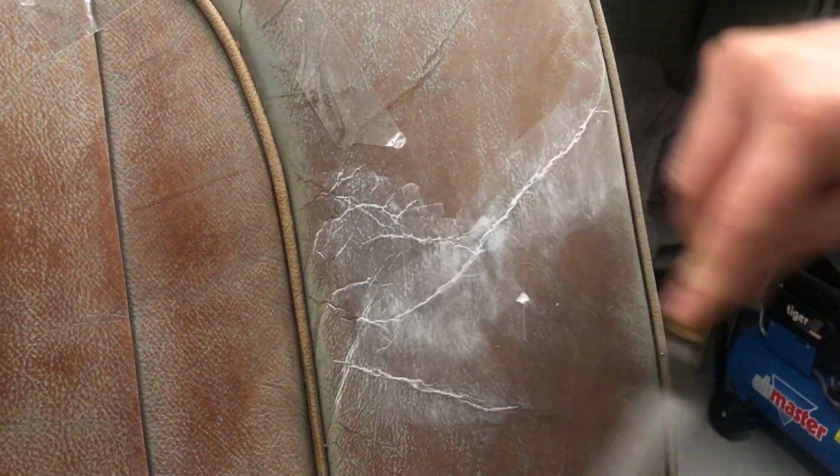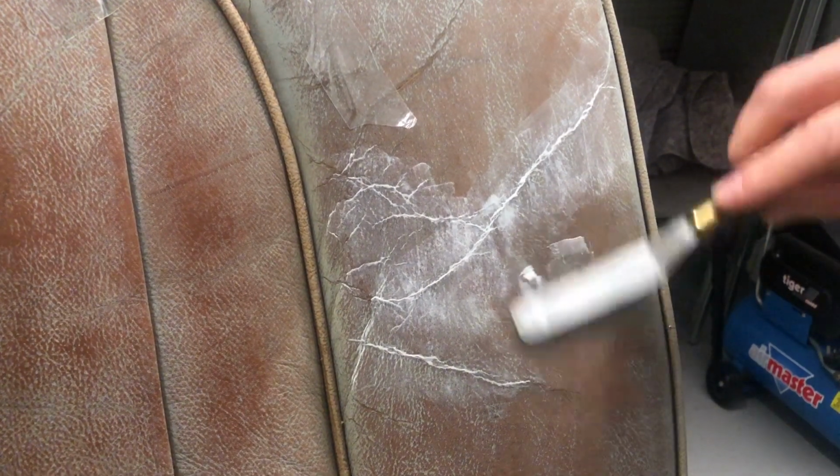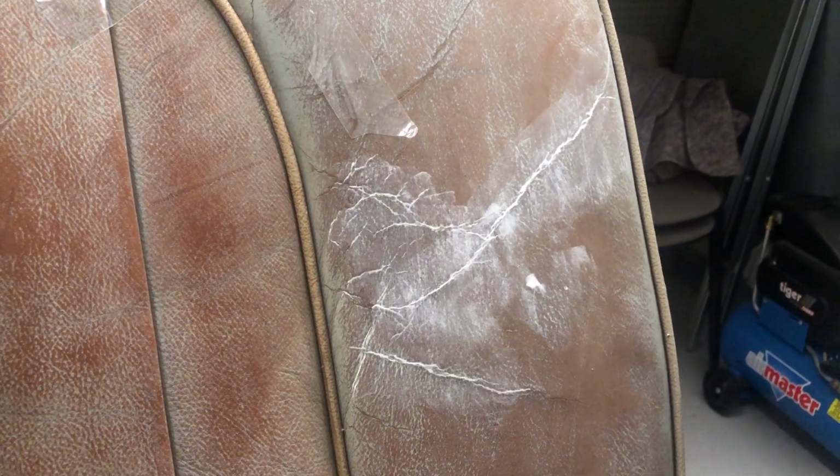You might find that with this cracking, once you've gone over this with the heavy filler and you've sanded, you're not going to tell whether it's perfect until you've got your first coat of paint on these seats, which is obviously going to be the next stage that we're going to do. Once you've done that, you'll be able to sand it a little bit better and tell whether you need to put any more filler in there. And if you do, you'd best put in the Flexi Filler, because the cracking's much finer. It's a bit like putting a guide coat of paint on a car. Put your primer on, put a guide coat on, and then flat it off to see if there's any imperfections in the paintwork to smooth out before you do any other work.